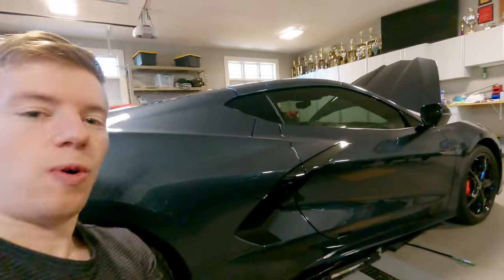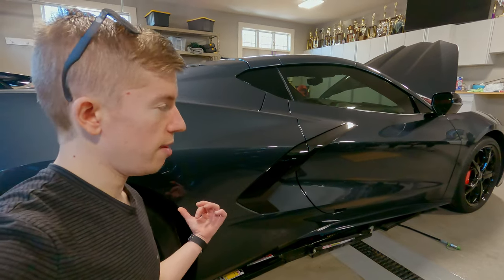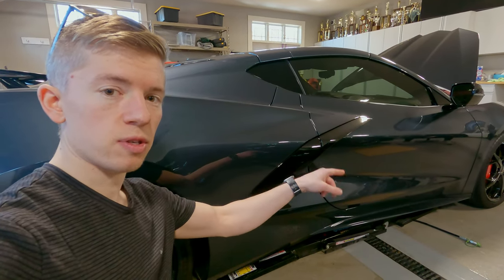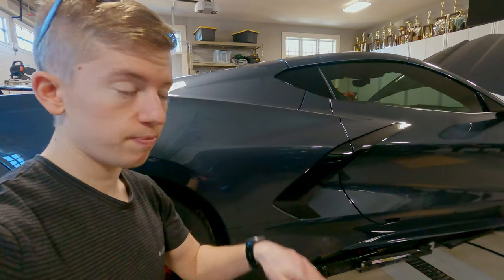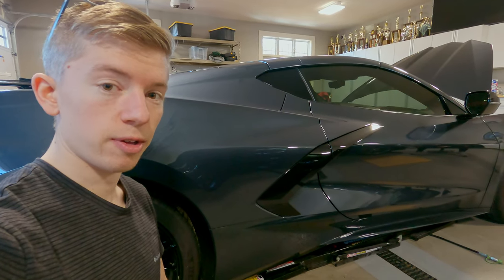If you don't have the lift system, you have adjustable coilovers front and back. But with the lift system, you have to install these lowering collars in the front, and then you can adjust the back to match and lower the car. Otherwise you just twist some collars front and back on the regular ones.